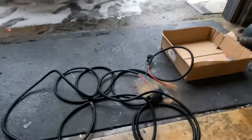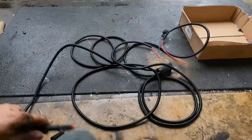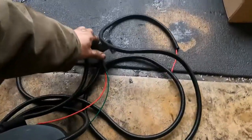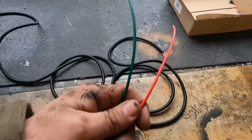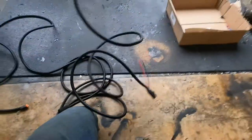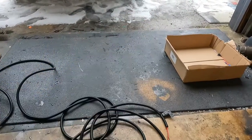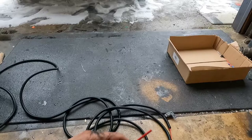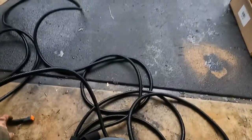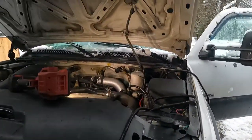Although I couldn't find the instructions online — the links just went to other products — I coiled up this wiring mess and it's pretty easy to figure out. This end plugs into the probe, there's a junction here with a small fuse, the main wire with a fuse connects directly to the battery positive and negative, and then there's a solo wire that taps into the fuse box on an ignition-switched circuit so it only has power when the key is on.